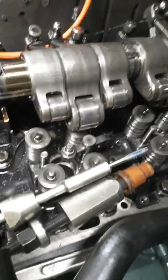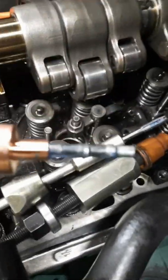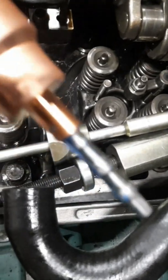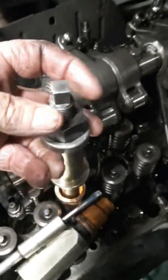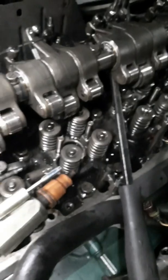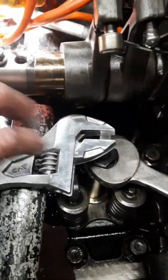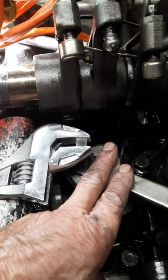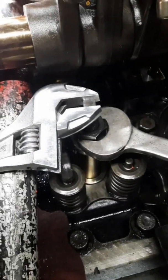And then when you're ready, after you clean up, put them in with this tool. Put your cup in there — there's a three-way flare right there, it's going to go in three steps. Pound it in, then start tightening it up. Make sure your piston is down; you don't want the piston to be all the way up. Once you get it tapped down in there, you're going to hold this wrench, turning this one. You're going to feel it get tight and release three times, then the tool will be in your hands. D-12 Volvo cup replacement.